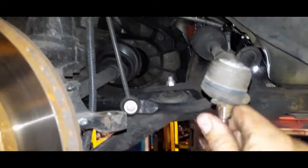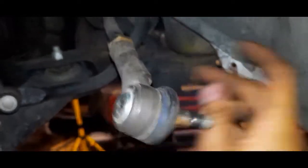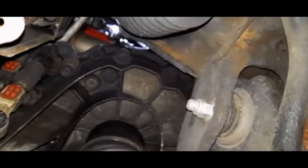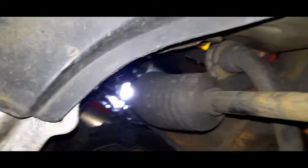So same again around this side, took the track rod end off, loosened the nut so that I can just unscrew this track rod end, because I'm going to need to use that on the other rack. Not so bothered about turns because I'm going to have to retrack it anyway, as you always should after swapping a steering rack. So there we go. That's off. Put it up there out the way. What I need to get to now is in here. There's a 19mm bolt which is here, so I need to take that off. Same the other side, they're easy enough to get to on this, so hopefully it'll come out.